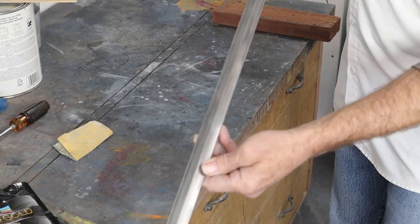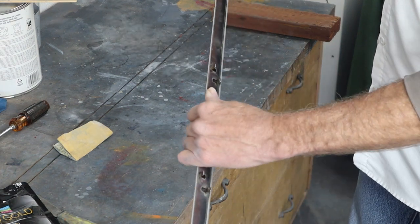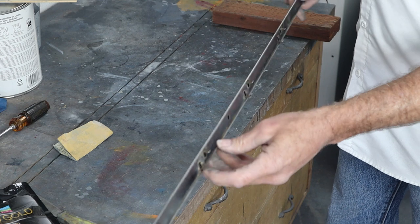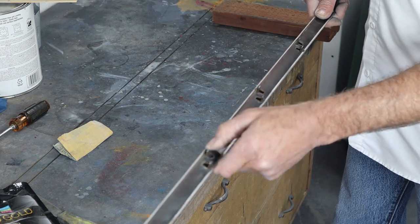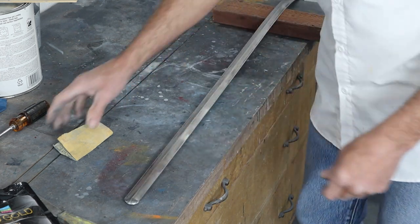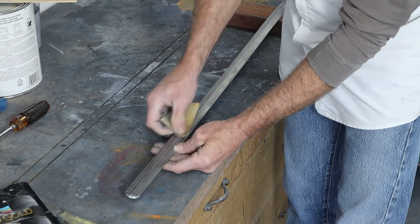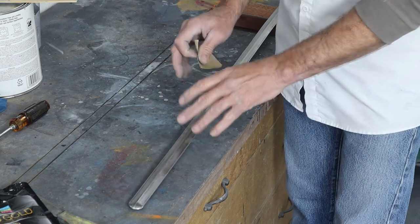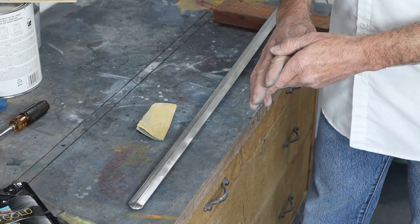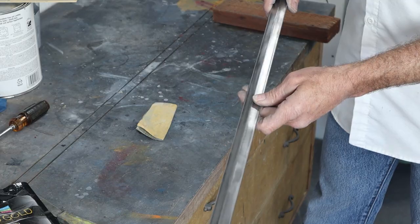That came out pretty well. I was able to just do it with the big wire wheel on the polisher — didn't have to switch to the little one and didn't bend it or get it hung up. I probably should have straightened the tabs out after I wire wheeled it since the wire wheel did hit a few of them, but it looks like it's working out. The next step is to take some 220 and hand sand the whole thing, keeping an eye out for any dents, kinks, or spots the paint was hiding. Then I'll wipe it down with some lacquer thinner, retest fit it on the hood, and if it fits good, we'll mix up some etching primer and get it sprayed.